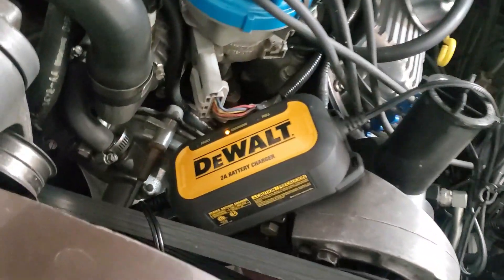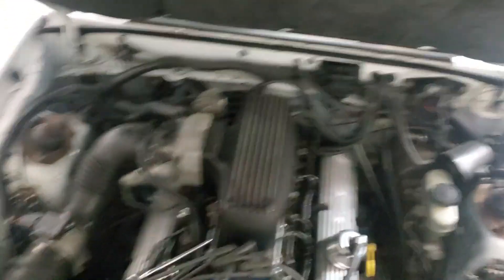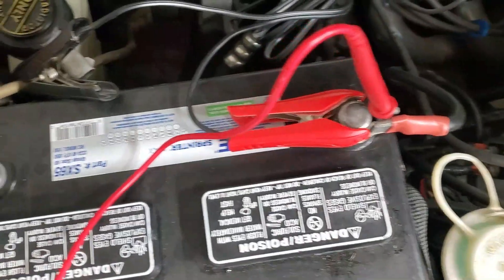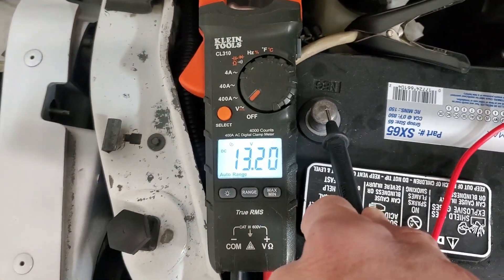It is the next day — Tuesday now. Looks like we're still charging, though that doesn't necessarily mean it didn't hit full already and just went back into the charging cycle. I'm going to get my meter and have a look at what we're sitting at on that battery. After sitting on the maintainer it should be somewhere in the 12 to 12.5 or 13 volt range. I unhooked the negative so we're not measuring the charger — 13.2 volts.